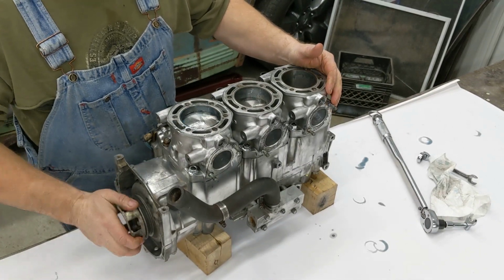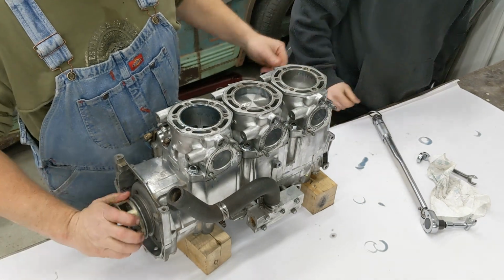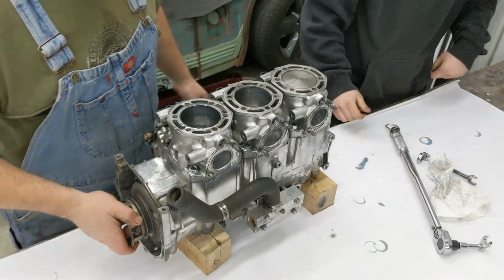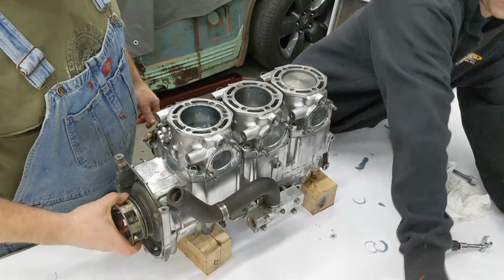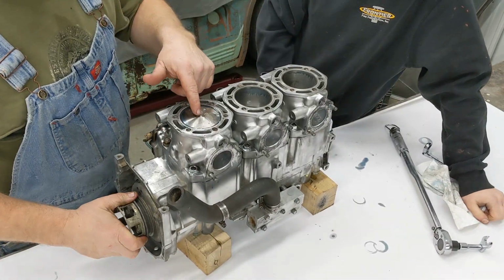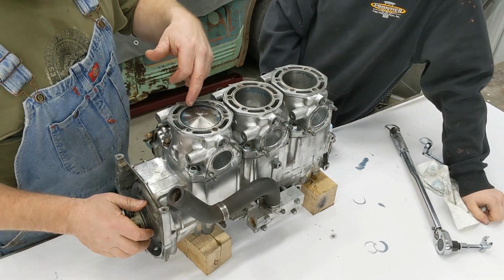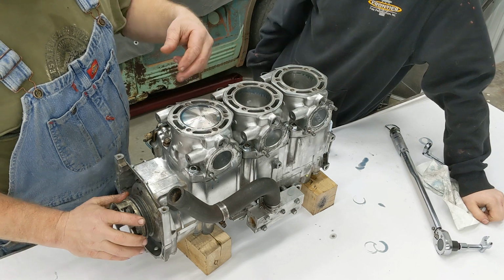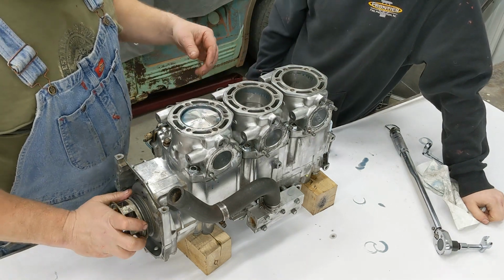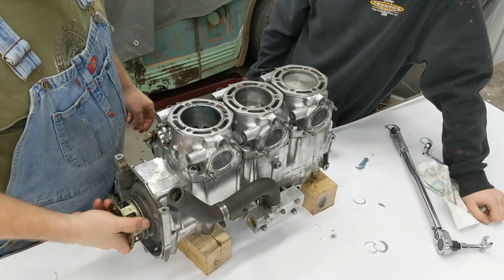Check for everything rolling nice and smooth. We'll put a little bit more oil in here too on these cylinders. I mean, they're cast iron cylinders, so they are really prone to rusting, but oh, this thing feels just beautiful. These pistons look just gorgeous in here. Brand new Wiseco pistons. We checked our wall clearance at 6 thousandths. We checked our ring gap at 13 thousandths. They suggest at least a 12 thousandths ring end gap, so everything's looking just gorgeous here.